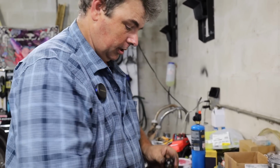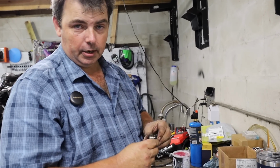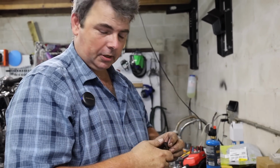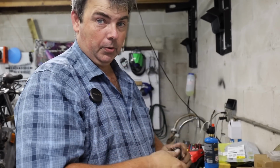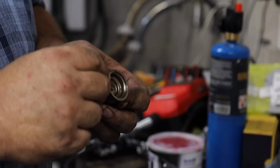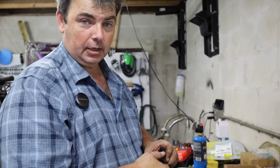He had let his rear brakes get so bad, not only were they grinding metal to metal, the pad that the brake caliper piston rested against, it ground through the metal backing plate, and it actually ground about 1/4 of an inch off of the edge of the brake caliper piston itself.